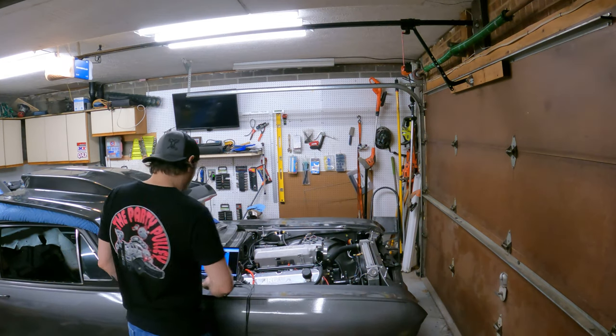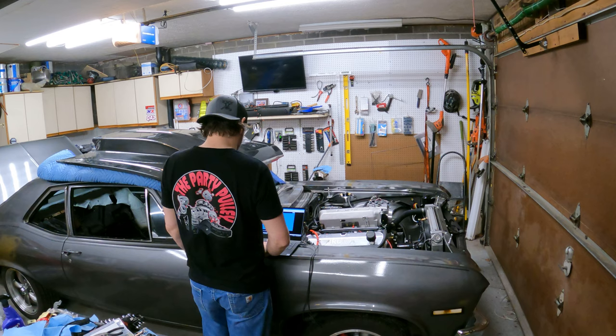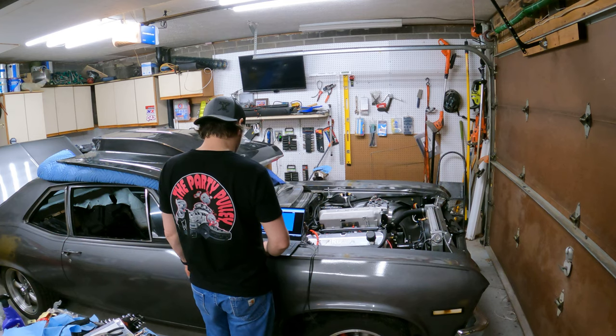Okay, it's a no-go so far. What we're seeing is a cam sync error from the dual sync, so I'm going to have to do a little digging, see what I can figure out and get that thing to keep syncing properly. I'm going to dig through the tune a little bit. I don't know that we're getting enough fuel — I just hit it with a couple shots of brake cleaner into the intake manifold and it fired instantly, then died as soon as that stuff burned off. So we're going to crank up the fuel on the volumetric efficiency table, just bump it 20 percent, and sync this in.